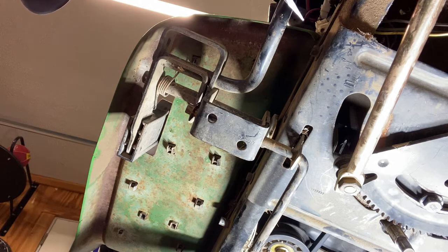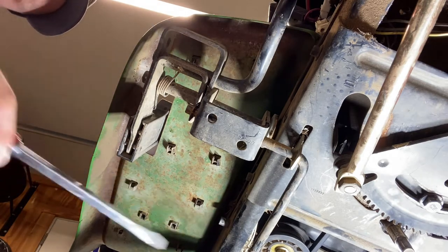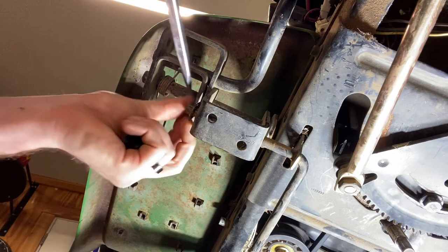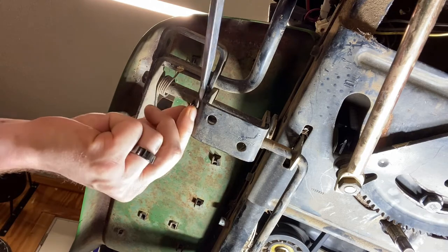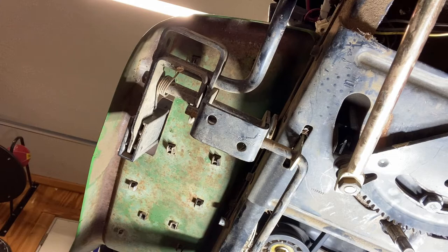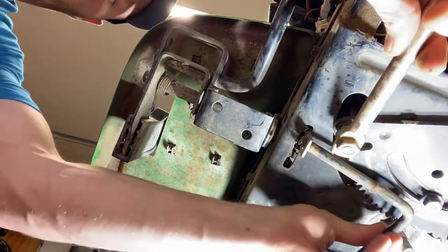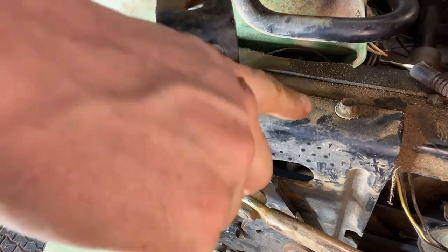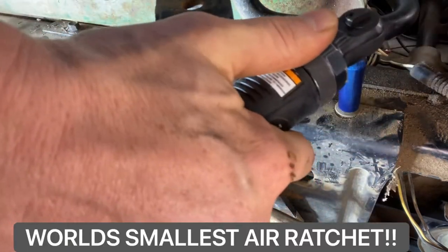The next step after you get the pinion gear off is to take off the mounting brace that the sector gear is held to. It's got two bolts on each side, but in order to pull it off you have to remove this bar — that's the clutch pedal. It's real simple: it's just got a little clip that's just pressed on there and comes off with a screwdriver, preferably a big screwdriver. You pop that off and then you can just pull it on out — sometimes you might need to turn the steering wheel a little to get it out of the way. Once we get that clutch pedal out of the way, we can take off these two 10mm bolts holding it on there. I'm using my mini air ratchet to get her done.